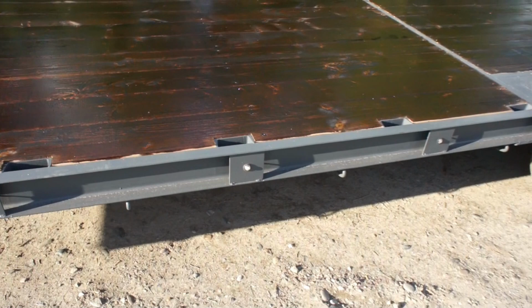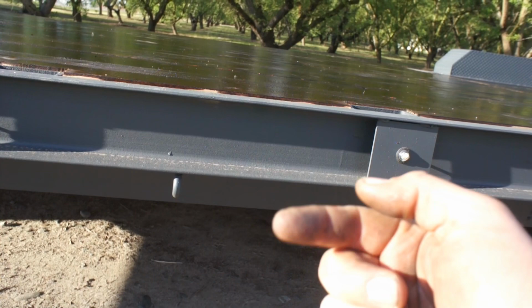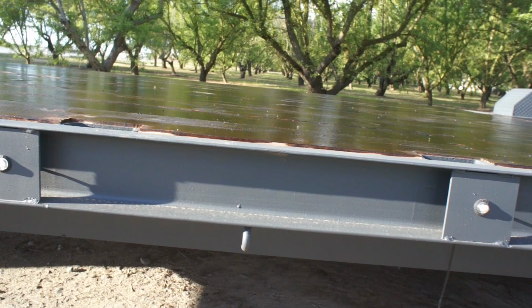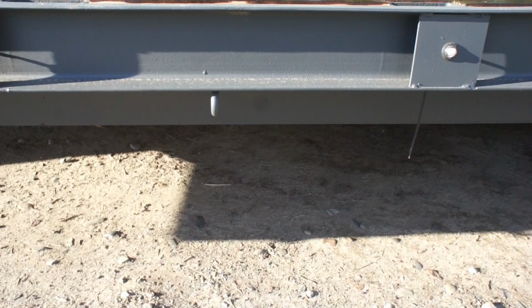There's a few things that I will be addressing down the road. One is, I think I'm gonna put the spare tire underneath here. What I'm considering using is one of those strap winches right here, and then a pulley under the trailer that pulls the tire up. With all my measuring, it looks to me like the tire would not hang below that frame rail right there, and that'd be a perfect way to keep it up and underneath there, out of the sunlight and secure. And then you would basically just need a lug wrench to lower it down. That's kind of what I'm aiming for.